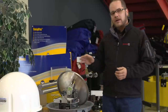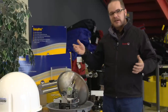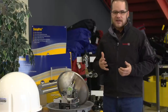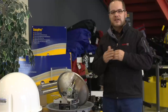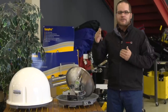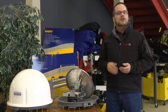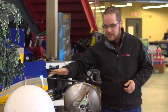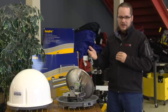These are never going to pick up as much signal as you have on your house. Generally, when you have a dish on the side of the house, you experience anywhere from 60 to 80% signal strength. The smaller dishes like this are actually designed to operate on anywhere from 25 to 45% signal strength. Lots of people say that's not so good, but that is actually fine to pick up standard definition channels. These little dishes cannot pick up HD programming, so that lower signal strength doesn't affect them a whole bunch.